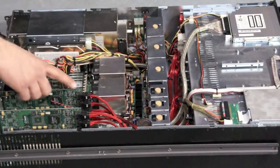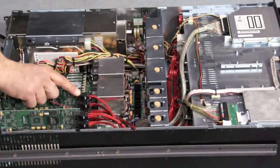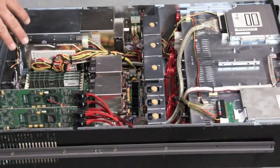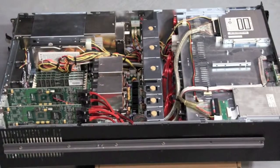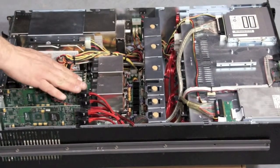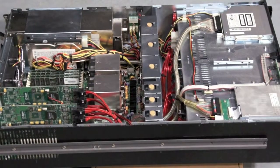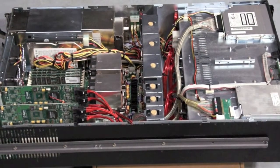Another feature about these RAID controllers is they don't have the multi-lane connectors. This is just a little bit different as far as the cable harness. But if you plan to change the RAID controllers, you need to go to individual SATA connectors. Each of these has 8 SATA ports. The other one we looked at had 16 with the higher density multi-lane connectors.